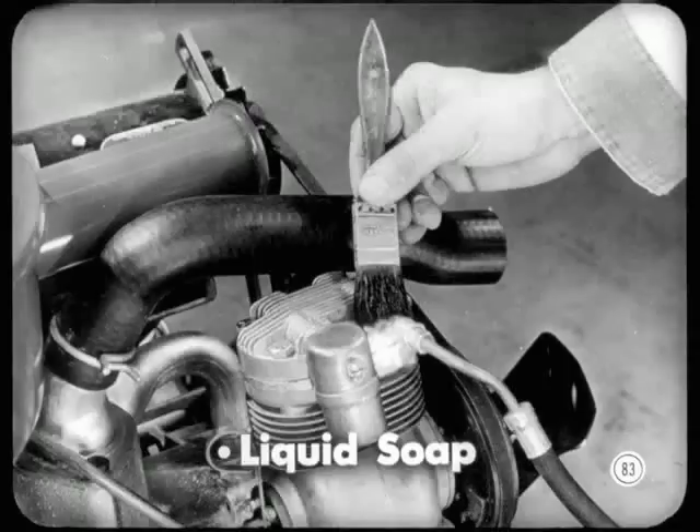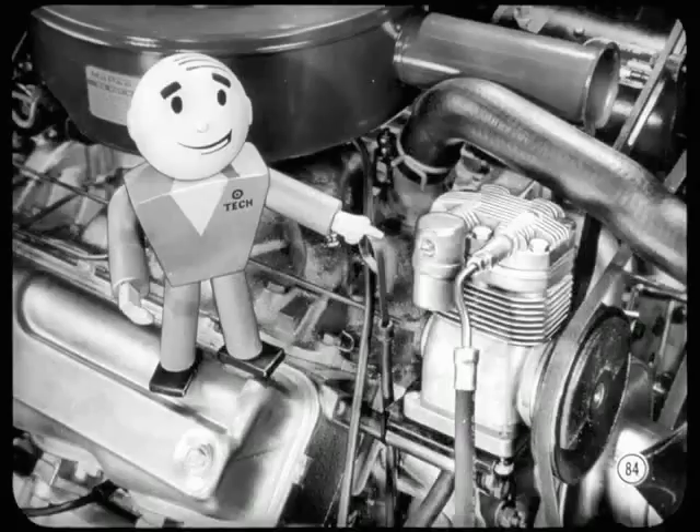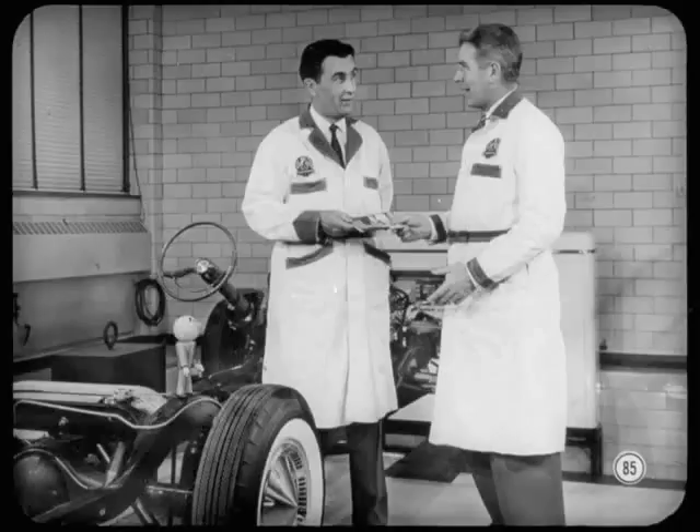To find leaks in the system, do what your gas man does when he's tracing leaks — brush liquid soap over all seams, joints, and connections: drain valve, air springs and seats, and the height-control valve mounting. Then, when the engine runs and the system's full of air, any that gets out will form a bubble at the escape point. You'll find all the things to check are listed in a reference book, along with other service tips. Study it when you have some spare time — that book's going to be a lifesaver.